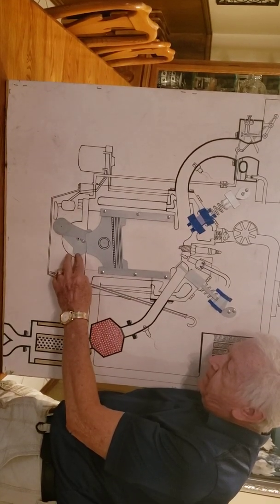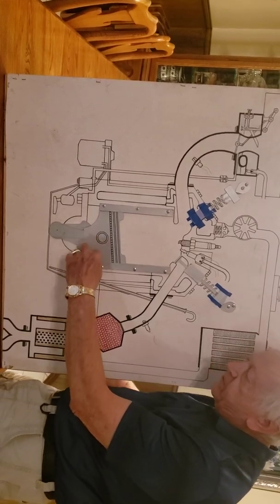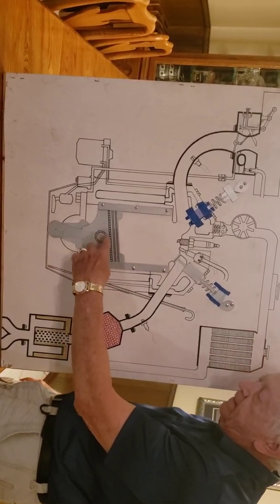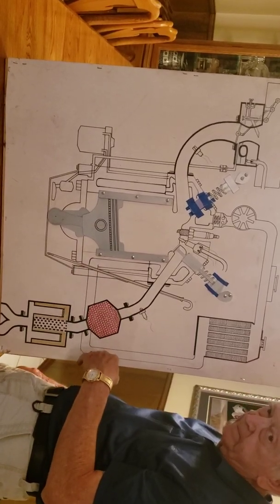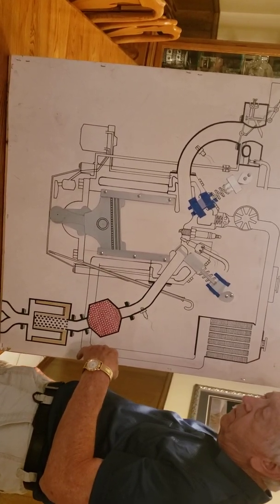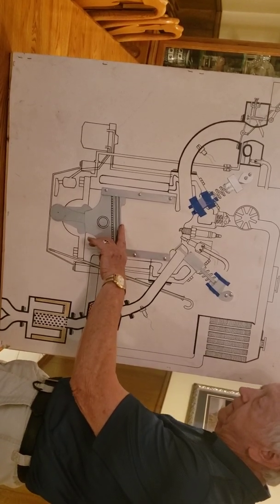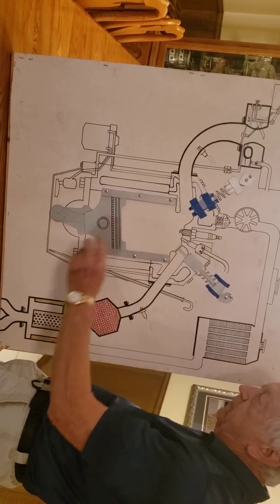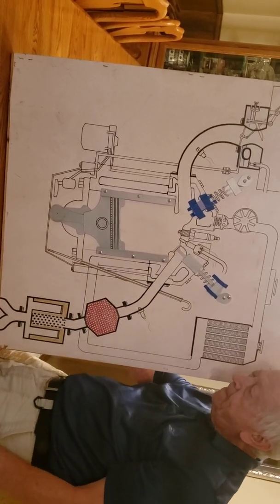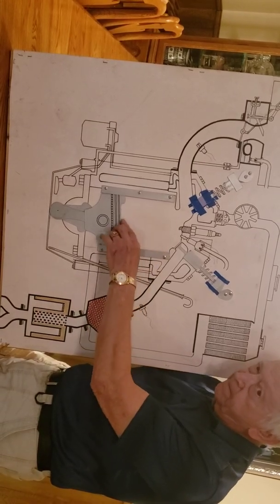And it's set for a while, so the piston goes all the way to the bottom like that. It turns this crank in a circle, and this crank is hooked to your transmission, which is hooked to your rear wheel. So that causes your car to go. Now, when this is all the way down, that's your bottom stroke from the compression that went off from the explosion. But now we've got to get rid of all that old gas that's in there.